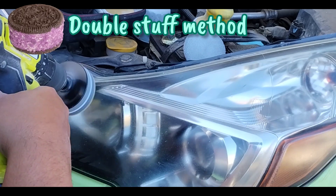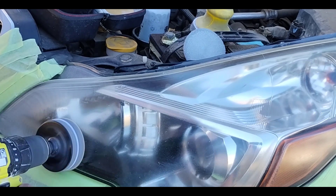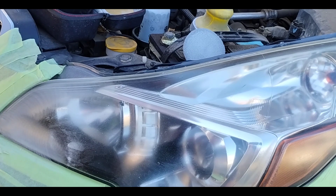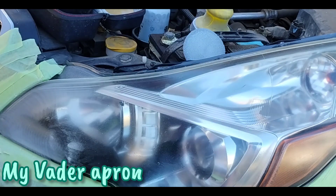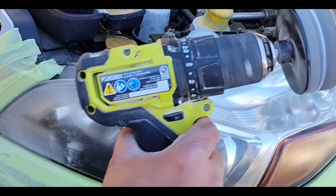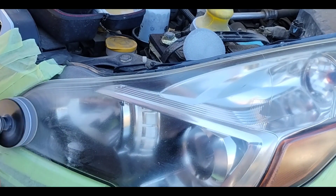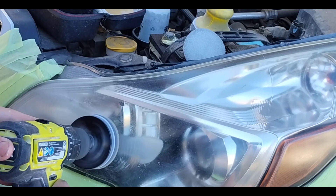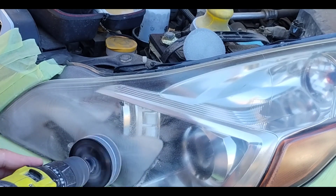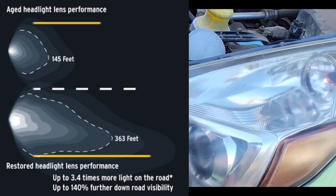Because you can't see in certain spots, or it's really hazy in certain spots, this particular light is going to deflect and reflect light different ways — it's going to scatter the light, not only blocking it but scattering it. So instead of a straight beam like a focused flashlight, which is how your headlight's supposed to work, these lights will perform more like a street light — just all over the place, not focused, which messes up your field of vision and your driving.